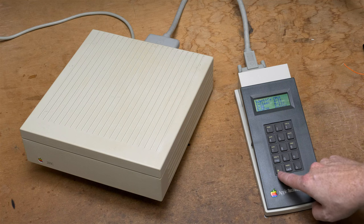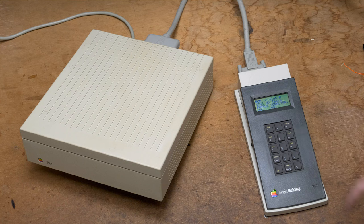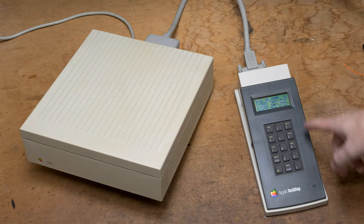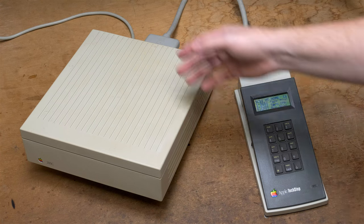To choose the ROM, you have to push the asterisk key - which is the shift key - and then choose ROM B. It then says ROM in slot B: SCSI hard drive tests. It asks you which test you want to run. Of course, we haven't switched on the power to the hard drive yet, so we need to do that now.